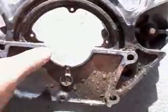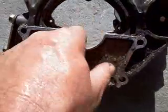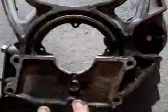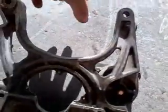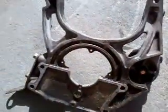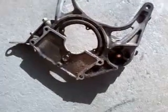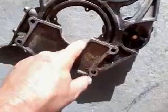But hopefully next time, if there is a next time, that somebody has to do just the oil seal, or if the one we put in leaks for some unfortunate reason, we can avoid having to take all this whole assembly, which includes the alternator, which sits in here, and this whole bracket, which is a real pain. It takes you about an hour at least if you haven't done one before, because you're really not sure where the bolts are and all that. And this would just save probably about an hour's worth of time having that cut out right there.